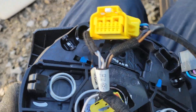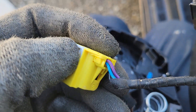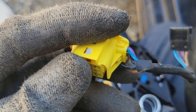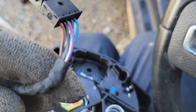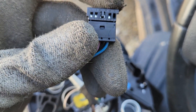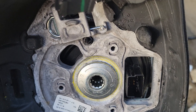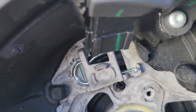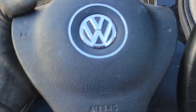Once that's done, you'll have a giant plug here to remove. You'll have this white safety clip that holds it in to keep it from falling out, so you'll pop that up and should be able to remove it. This one has controls on the steering wheel for phone and all that, so you'll also have this extra plug that needs to be popped out of the wiring clip inside. That's the gist of getting this airbag out.